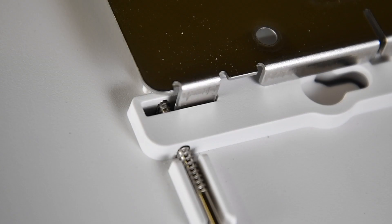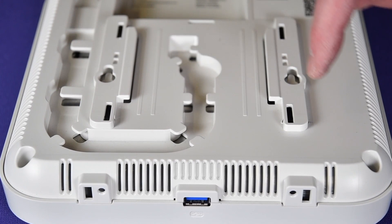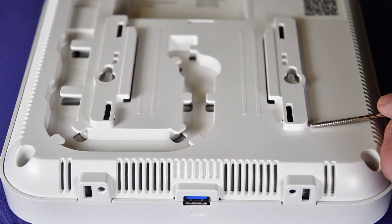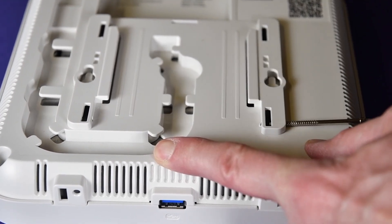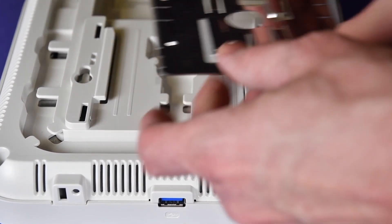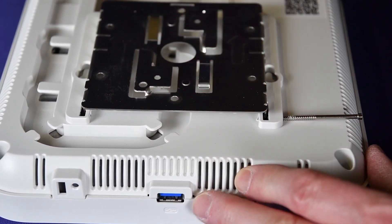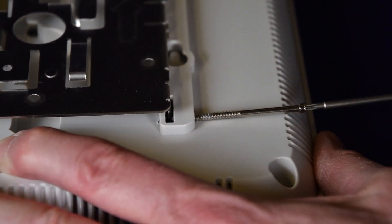There are also screw guides on the 510 series access points. Line up the security torx locking screw using the rear guide on the access point, then tighten the security torx locking screw using a T8 bit screwdriver. Turn the locking screw into the security screw hole until the security torx locking screw passes through to the other side and touches the screw stop feature.